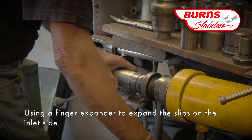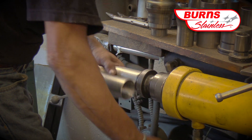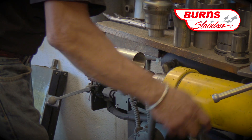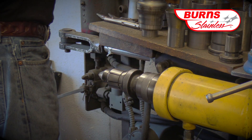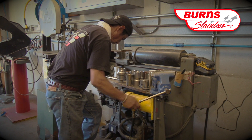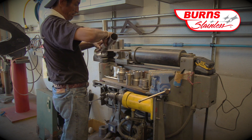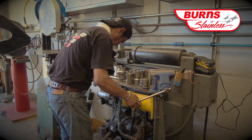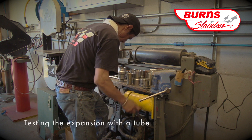Next, we'll be expanding the inlets so that they slip over a primary pipe. Fernando is using a finger expander — a very old Bend Pack machine that Jack has had for many, many years, just one of those favorite tools we have in the shop. At this point, Fernando is actually putting a lot of body English into the collector. The inlets ended up being a little bit out of parallel following the welding because of distortion. By cleverly moving the collector and manipulating the expander, you can actually get those to come out parallel.